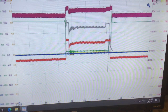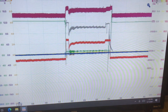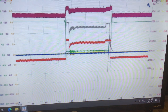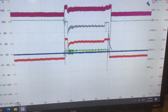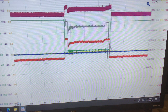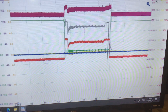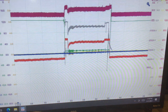At the beginning of this part two, as you look at your schematic, this is definitely with fuse 8 removed. So things will start to make a little bit of sense here. As you look at your schematic and you see fuse 8 removed, you'll see that the PCM cannot get power on pins A3 and A2. That's the yellow and the purple. The crankshaft cannot get power. The pin E7 can get power because that's a separate feed, because we always have to watch our schematic.